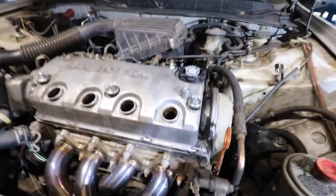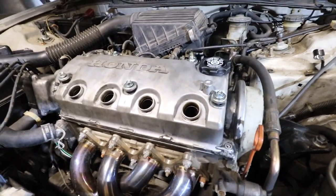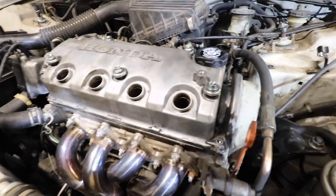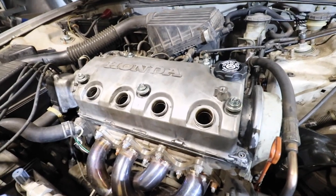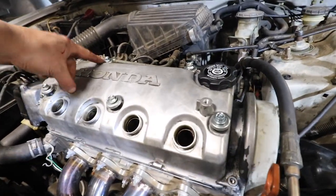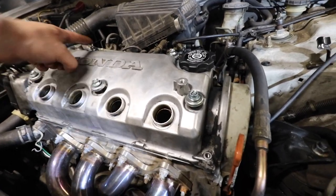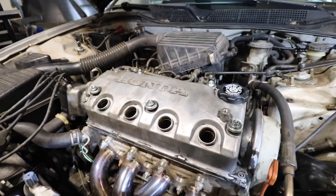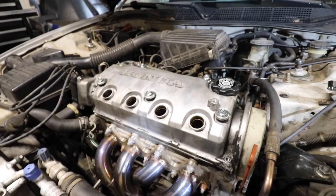One thing I did read — I don't have a torque wrench that will tighten these down; mine only goes from 20 to 100 and we need to go lower than that. But pretty much tighten these down in an order, then go back through and finish tightening — snug at first, then give it another pass in that same pattern.